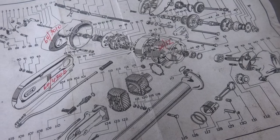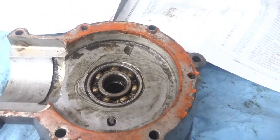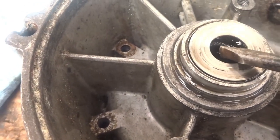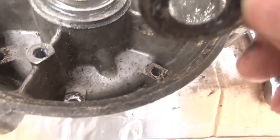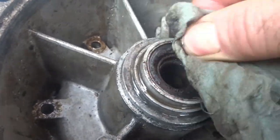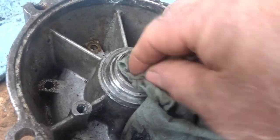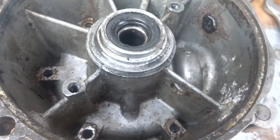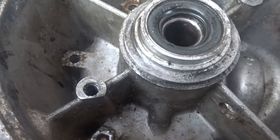I'm waiting on a puller set — there's a special puller set for getting these types of bearings out; what I have won't do it at all. I put a screwdriver on that to see what it was and it's just a heavy washer protecting the oil seal. The oil seal looks a small bit on the damaged side — some stuff coming off of it, though it's probably just old grease. I'll try and get that oil seal out.